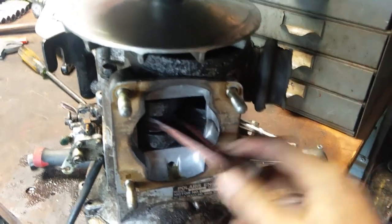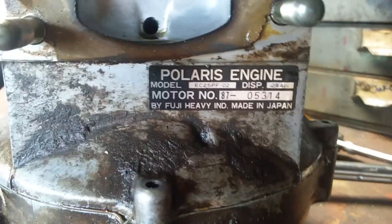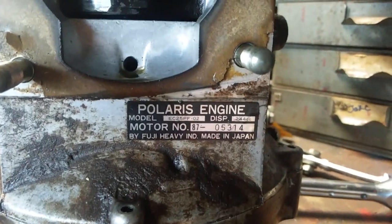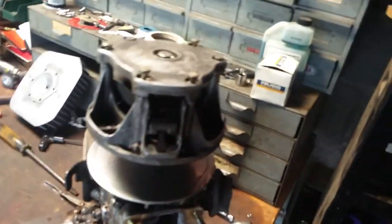Larry's gonna be back and better than ever. I've got most of the aluminum cleaned out of the crankcase. The big end bearing is good enough. This is a Fuji motor, just so you know. I figured out today that the crank seals are bad - when I filled the crankcase up with gas just to wash it out, it was just pouring out the side on the shaft. So I gotta do crank seals. I'm gonna have to either make a puller or actually buy one.